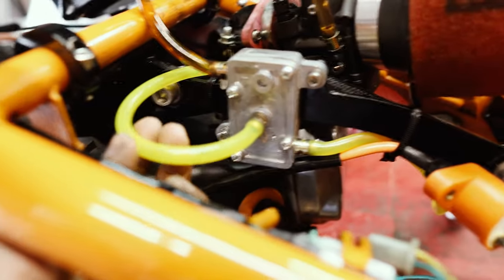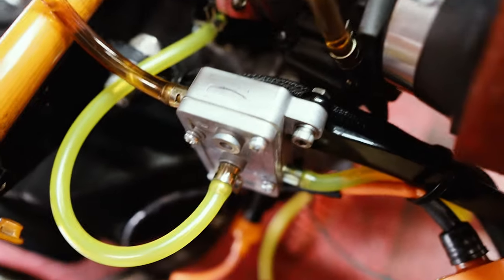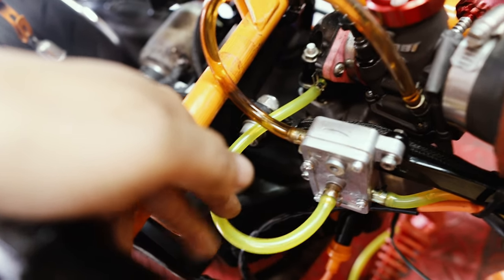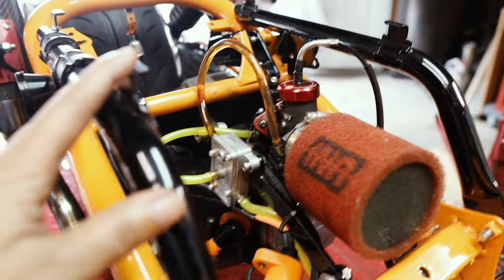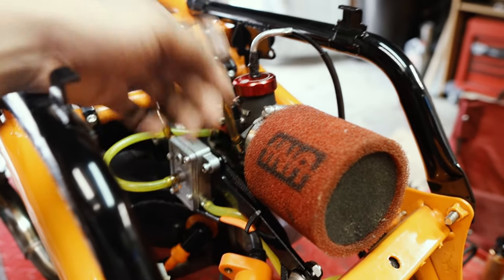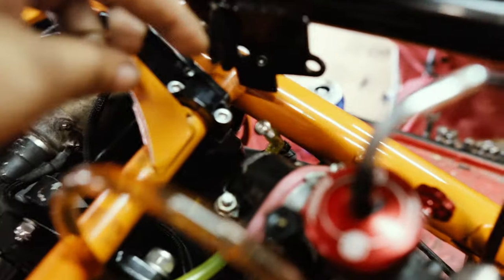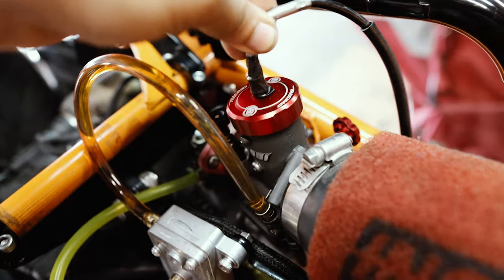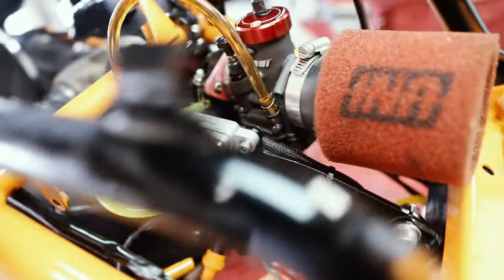I also redid the fuel line — it is this yellowish-orange color, but note that this is actually a vacuum line. Every hose has a clamp on it now; they didn't have clamps before and would come off. This is the vacuum line and I probably should have used a stiffer one because when you start it, you can feel it vibrate. Quick story: I was trying to do a test start and it would rev down super slow when I let go of the throttle, and I'd put my hand in front of here and it would throttle up. Turns out there's a breather tube in here that I forgot to plug — when I plugged that, it started running normal again. My throttle is loose in here; I need to figure a solution out for that, but at least the fuel pump works well.